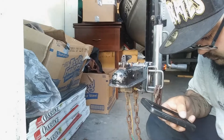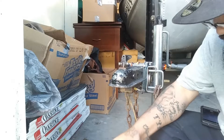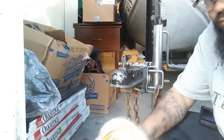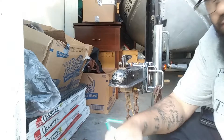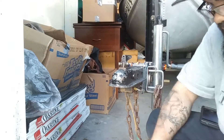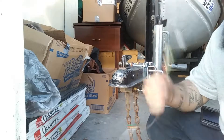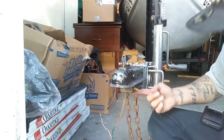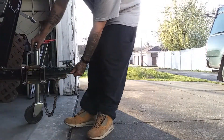Right here I'm actually taking a picture to make sure I put the wires in the correct place — they're color coded. I originally planned on just changing this trailer wiring harness, but it ended up actually needing completely rewired — the whole trailer — because none of the lights would work. The wire was just really old and brittle, and everything was breaking as I was trying to fix it, so I ended up having to replace the wire all the way down through.